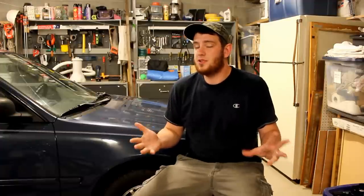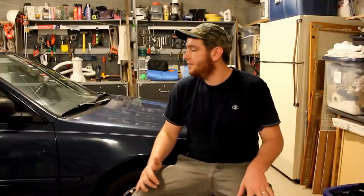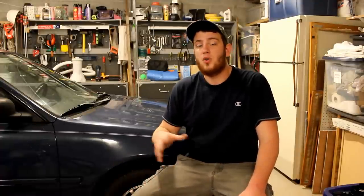On today's video, I'm going to be showing you how to replace your spark plugs for your car in general. I say in general because this is kind of a generalized video showing you how to remove your spark plugs, because on about 90% of the cars it's pretty much all the same. You remove your plug wire, stick your socket down in there, take the plug out, and that's what this is going to be today. I also have another video showing you how to remove spark plugs with the coil-over-plug style spark plug.